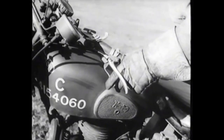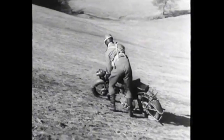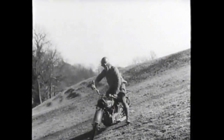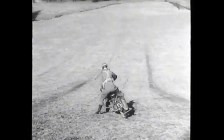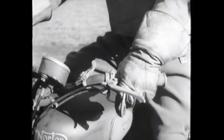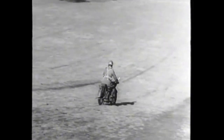Checking with the front brake, ease the exhaust valve lifter. Get the machine at right angles to the hill and leaned into it all the time. Put your foot on the footrest, not on the ground. Apply the front brake and work the handlebars until the machine points downhill. Then, by releasing the front brake and easing the exhaust valve lifter, but under no circumstances touching the clutch lever, allow the machine to descend the hill.